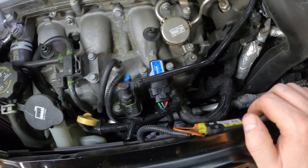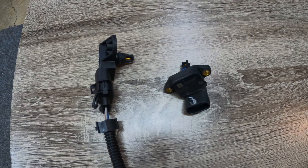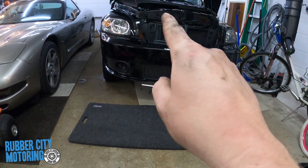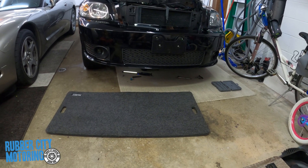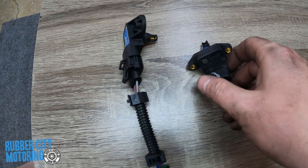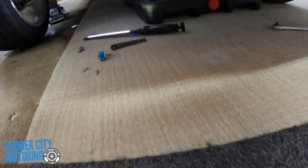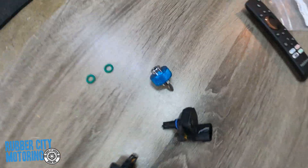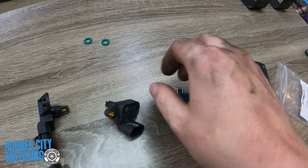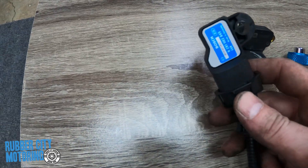Now we move to the fun one — the bottom one. Six and a half hours later... well, that took a minute. Basically, down below there are three 13-millimeter bolts on each side — I loosen those, then I loosen the top two 10-millimeter bolts up there, which basically just loosens the radiator. That gave me just enough room to go in through the bottom and loosen the screws that hold this MAP sensor. I used this little mini screwdriver — actually a stocking-stuffer one year. I could reach it in there and turn it by hand; they weren't very tight, and they thread into plastic.